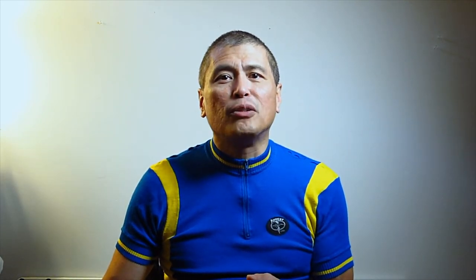And if you're aspiring to beat the next Mark Cavendish, you can even color your chain's outer plates to match your green jersey. If you wax your chain or use wet lubes, color the outer plates first, then wax or apply the lube. This won't affect the friction-reducing properties of the wax or the wet lube, since they work on the inner plates and roller bushings.